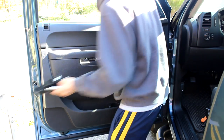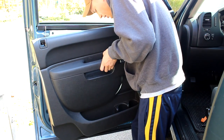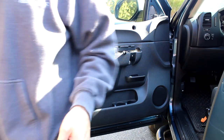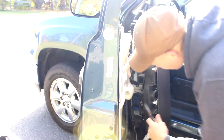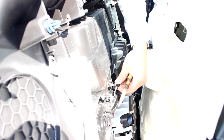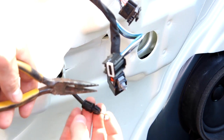You can't do it like that — I'm not sure if it will slip through on this unit. Now we're hitting one thing: the door handle cable. I'm going to try to film it as best I can. It helps to have a pair of needle nose pliers. Basically you have to squeeze this together and this will pull out, and you can slip the cable out. Then it will slide through the hole, and you've got to disconnect this from the joint. Then you can just slide that right out and take the door panel off.